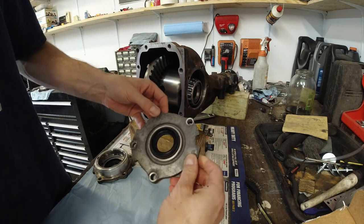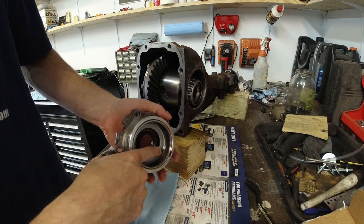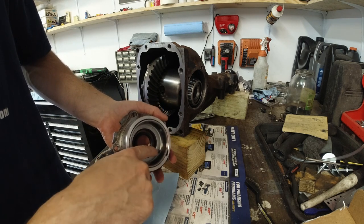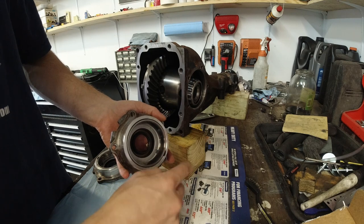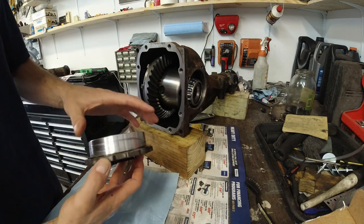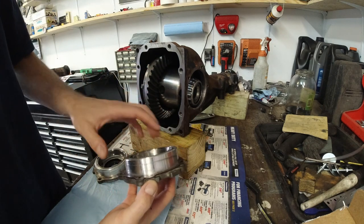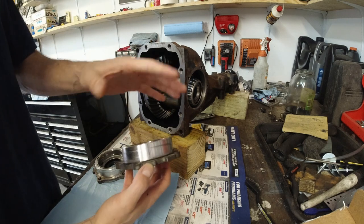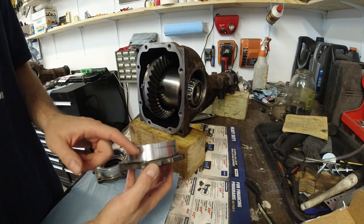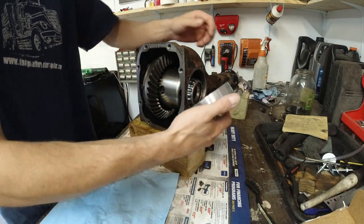Arrow will point down, mainly because of this oil gallery, I guess, the oil needs to go through here. So this will point down. I'm not gonna install the seals, these O-rings, right now, because if I do have to take it out, I don't want to be squeezing these O-rings more than once.